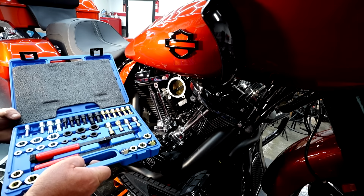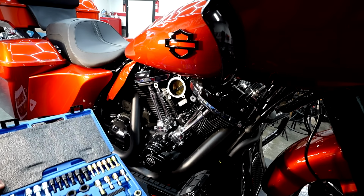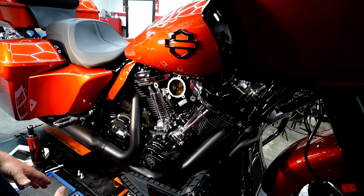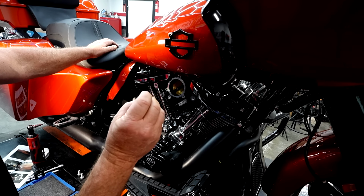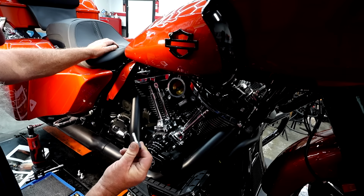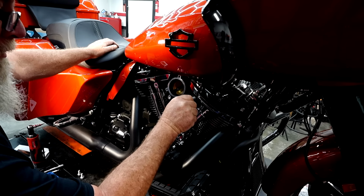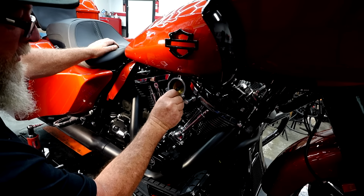Just real quick, this is the thread chasing kit that I have. This is from Amazon. It's very cheap. If you own a Harley Davidson and you're working on your bike, you need to get one of those. I'll put a link down in the description down below. It also includes the nuts so you can actually chase bolts as well. We have our 3/8 for the cylinder head holes here, and we have our 1/4 inch for the throttle body holes here.